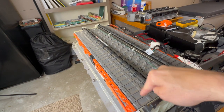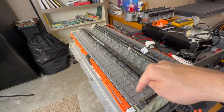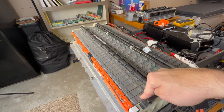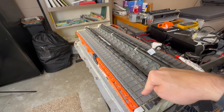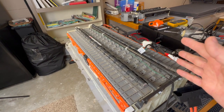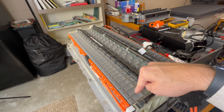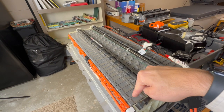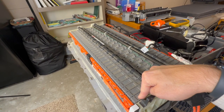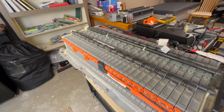Energy from this battery is going to flow to the motor generators and it's going to help propel you down the road. If there is not enough available energy, when this battery starts to get depleted, guess what happens to your car? Check engine light, poor performance, poor fuel economy, all of those things are going to happen if you haven't taken the time to understand what voltage drop means. If you have severe voltage drop of a volt or more, right, you're probably going to have a battery that's not going to perform the way that you want it to.